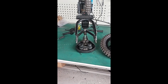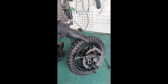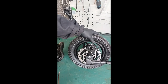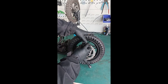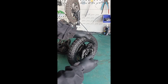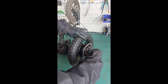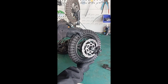Step five: we'll be installing the rear wheel assembly. All wheels come like this with all components installed already. Your brake caliper and all the bolts will be tight - you need to loosen the nuts. It's best that you remove the kickstand right now, that just makes it easier to deal with.